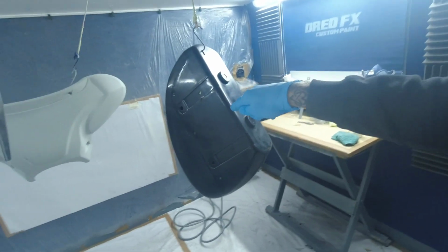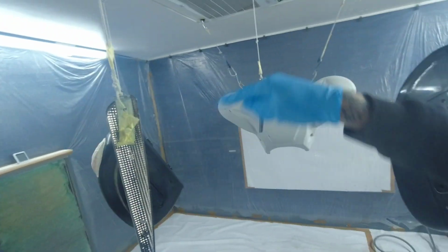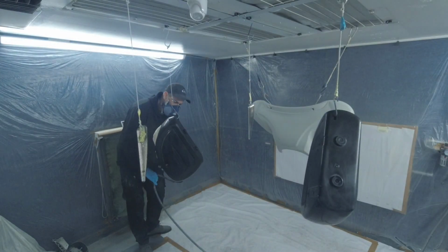Now we're going to use plastic primer, which is the Standox, straight out the can. I've got the DB1S set up, low pressure, and we're going to plastic prime that casing, and these two trims that are screwed to the side of this case. Back off to 20 psi, nice and light, and just do a light drop coat over these. You don't need to solidly wet these up, you're just doing a little grip coat in the plastic primer. So I'll stick it on the tripod and we'll get these into a primer. See you in a minute.